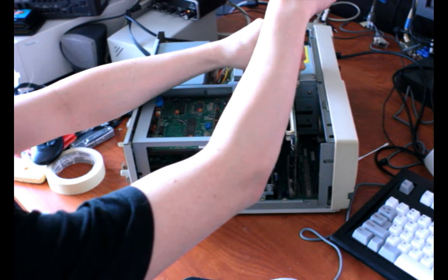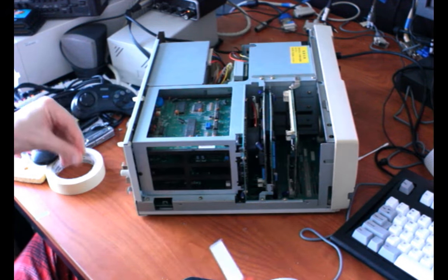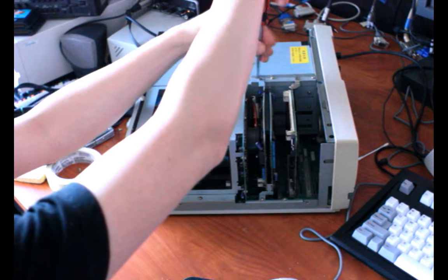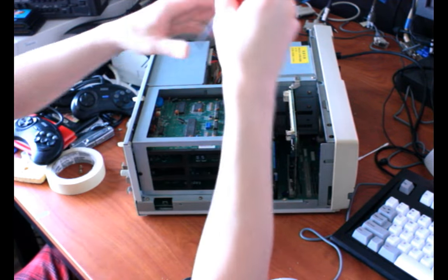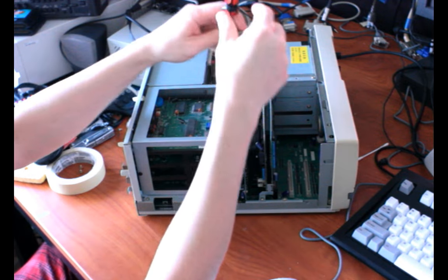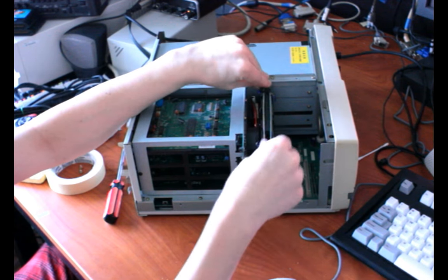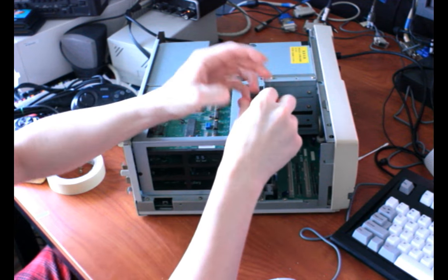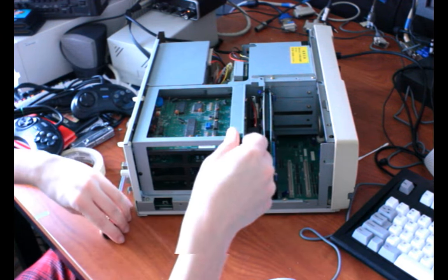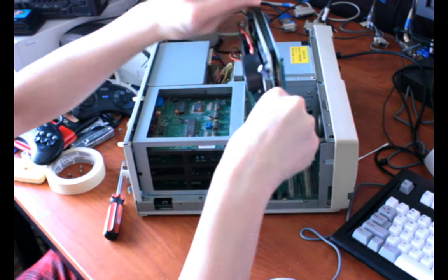The PC probably only came with the riser board and one card plugged into it, which was a high resolution board, which I actually don't have. So if anyone reading this happens to have an Epson 486GR and doesn't want their high res board, I would love it. There's not much use for them from what I can tell, since the high res PC-9801 models, like I think the 9801HA was one, aren't completely compatible with the regular operating mode, so you need to program stuff specifically for the high-res systems. And they use different addresses for things. So due to the lack of backwards compatibility, it seems like people say it's pretty useless, even on the Japanese internet. I've done a lot of research on the Japanese internet about this.